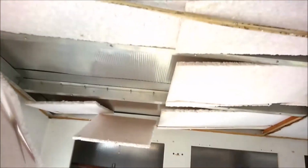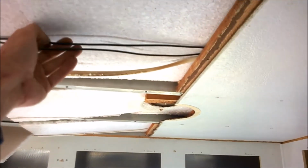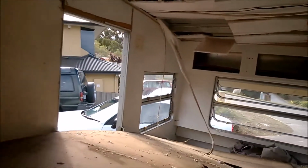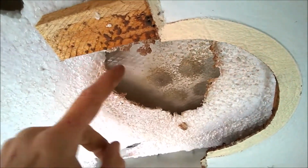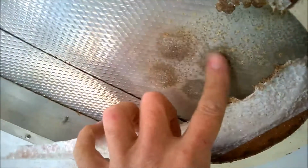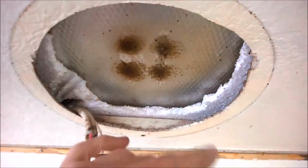Okay, and same deal, we've got all the electrical connections and insulation. It's another one here. Yeah, it's 12 volts. Anyway, so now we pull this thing apart. Just a little bit of a caution here. You notice that this has melted, which we believe is due to the 2 high wattage globes. And the same thing over here. A real fire hazard, that. So don't go putting in high wattage globes.